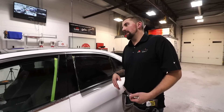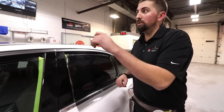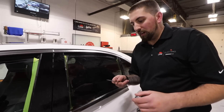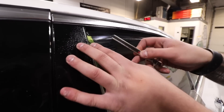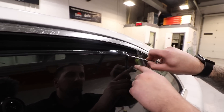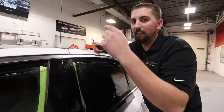Here at Tintworks this is what sets us apart from the competition. We do have the computer cutting machine, but when the film comes out the top edge is never perfect. What I do is put it on the outside of the window, make the patterns a little bigger in the system, then shave them individually to that specific window — so when you roll the window down there's no nasty gap.